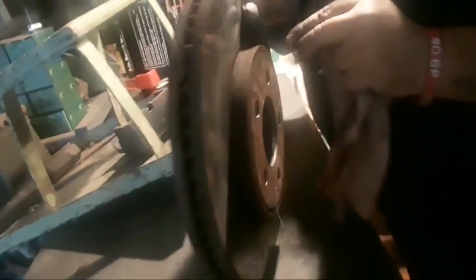By the way, folks, take a picture of that brake rotor before it's finished. You can see here, guys, there's graying and bluing from heat buildup in the rotor. There's probably a little bit of warpage on this rotor. I know there was on the other rotor I cut. But as you can see, these rotors are nice and thick. In fact, these rotors have never been cut before. They have had one brake job under their belt. Now this is the second one.